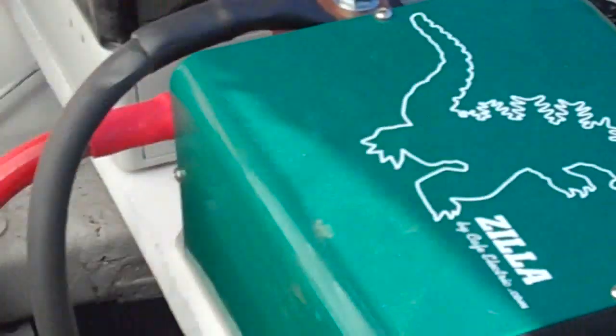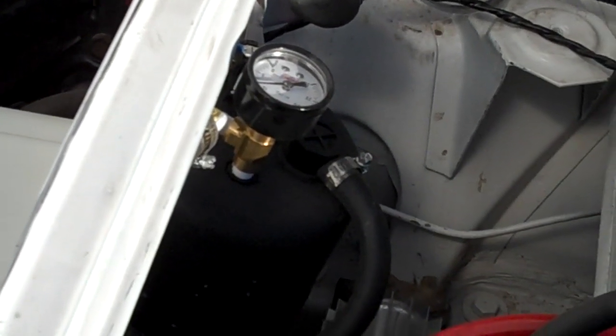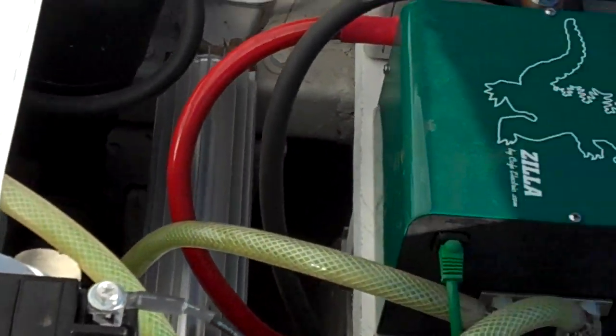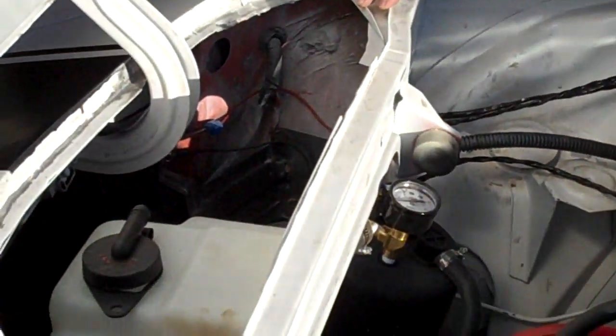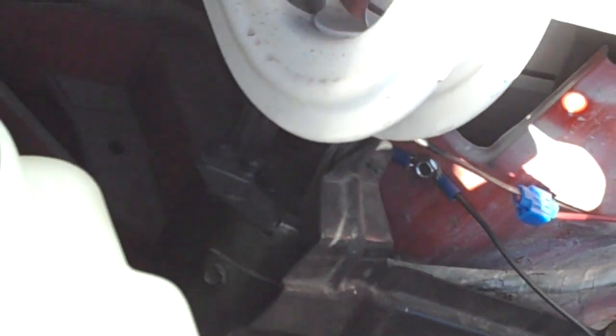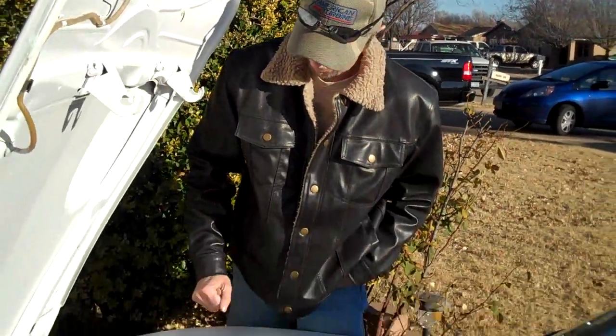This right here is a reservoir for vacuum. Because there's no combustion engine anymore, we have a vacuum pump, of course — like everybody else with an electric car, you need vacuum for the power brakes. The vacuum pump we used came off an old 1980s small car that actually needed one because the engine was so small it didn't produce enough vacuum for the brakes. It's a GM unit — I think it came off Buicks from '86 and '87.